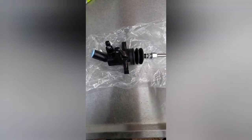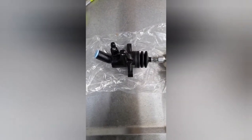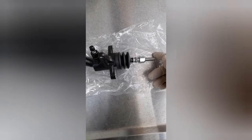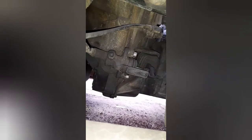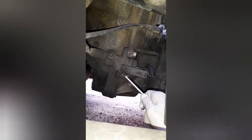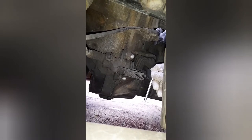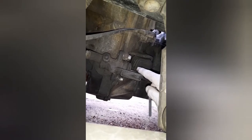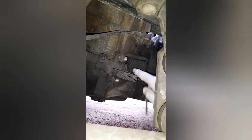What I'm going to be doing today is replacing the threaded rod on the clutch slave cylinder — just the rod itself — because it's threaded towards the end and I can't adjust the clutch properly anymore. I've got some washers in there to give it that extra push, but they keep wearing out, so I'm going to replace that rod.